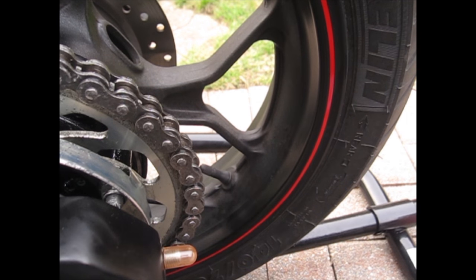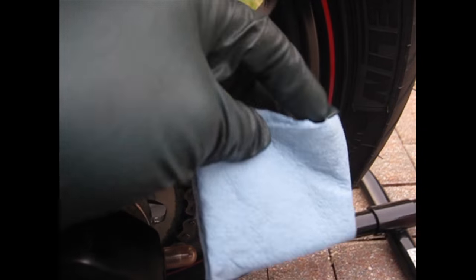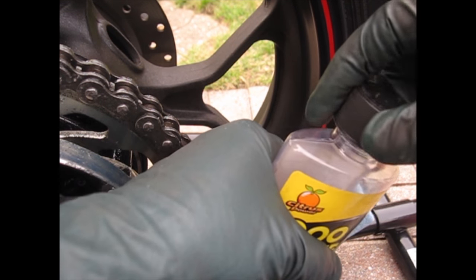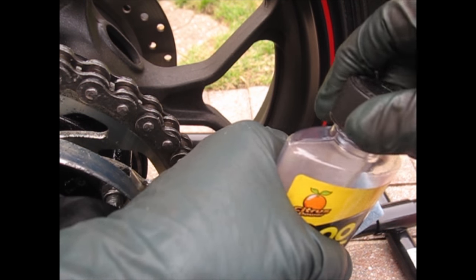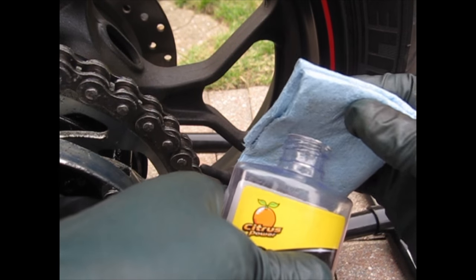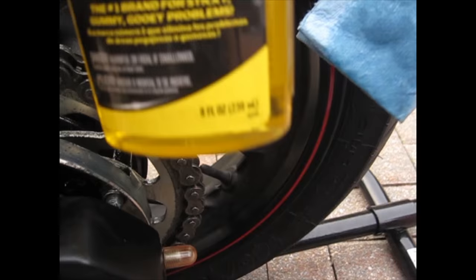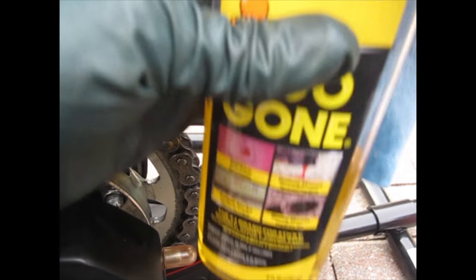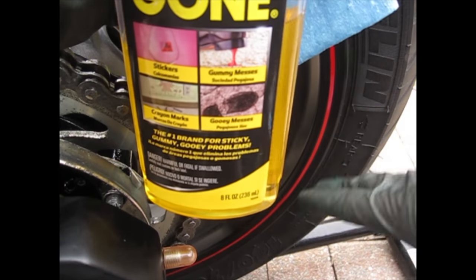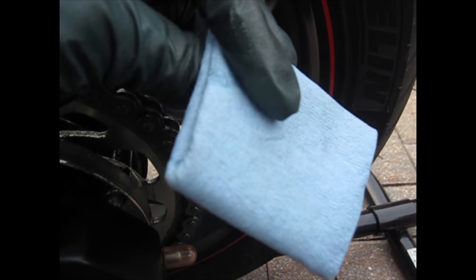Back to the R3 — what you want to do is get a blue paper towel, shop towel, rag, or microfiber cloth. Fold it and put just a little bit of Goo Gone on your towel — it doesn't have to be that much. Then go ahead and start wiping. As you're doing it you're going to see it leave some shininess — that's fine. Just do your whole wheel and then wipe off that shininess with the clean part of the paper towel.